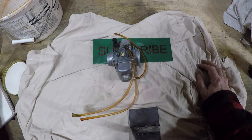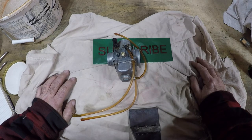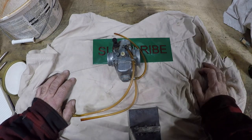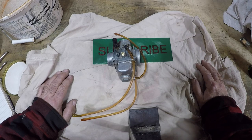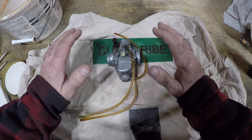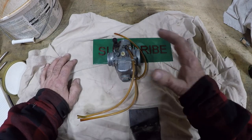This is an easy fix — we clean the carburetor and we're good to go. Unfortunately, the customer decided to attempt to clean it themselves and decided they should adjust the floats. Listen up: never ever adjust the floats. If the bike ran good when you parked it, then you let it sit and gas came out the overflow, that means it's all gummed up. The floats didn't get out of adjustment by just sitting — don't fiddle with them, just clean the carburetor.